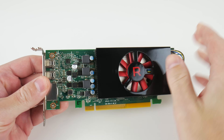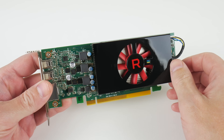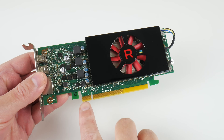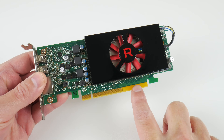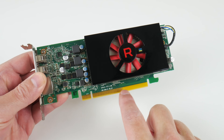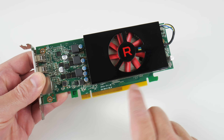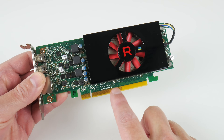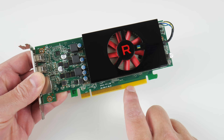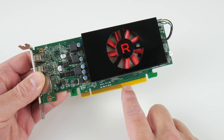This card is low-profile, and that's likely why you're watching this video. These are perfect for upgrading small form factor machines like a Dell Optiplex or HP Elite Desk. This is a PCI Express 3.0 interface but only using eight lanes. So if your motherboard is older with PCI Express 2.0, you will miss out on performance. The cutoff is going from Sandy Bridge (PCIe 2.0) to Ivy Bridge (PCIe 3.0) — think the i7-3770 and the i5-3570.